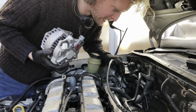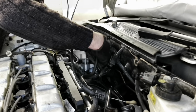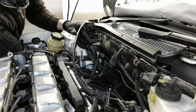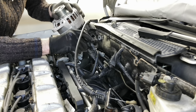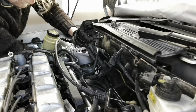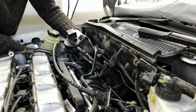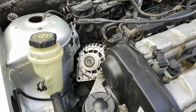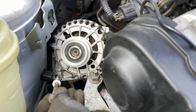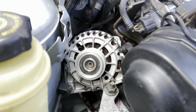Let's get you back on. Going to try it the other way - with the connector facing towards the suspension strut. The way to do it is to have the sticky-out terminal facing this way and it seems to go through a lot better. Before we sit that back in its cradle we're just going to put the furthest bolt away back in, because when it's back in position you won't be able to get this bolt in - it will hit the inner wing. Just rest that in there and then turn the alternator around and put it in its cradle.